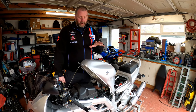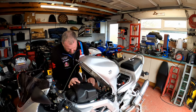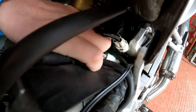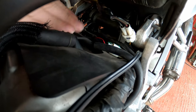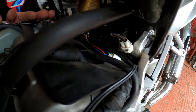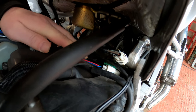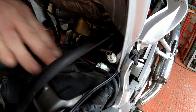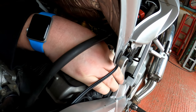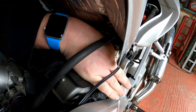Okay — seat off, side panel off, tank lifted. What we need to do is get under here, because we need to disconnect a connector. Right at the back near the hinge you can see there's a little cable clamp, one of these wrap-around style ones. Pop that out of the way and the cable we're looking at is this one here — it's got a blue, pink, and a black wire going into it, and this is the connector we need to disconnect. There's not a great deal of room in here, so let me pop it apart.